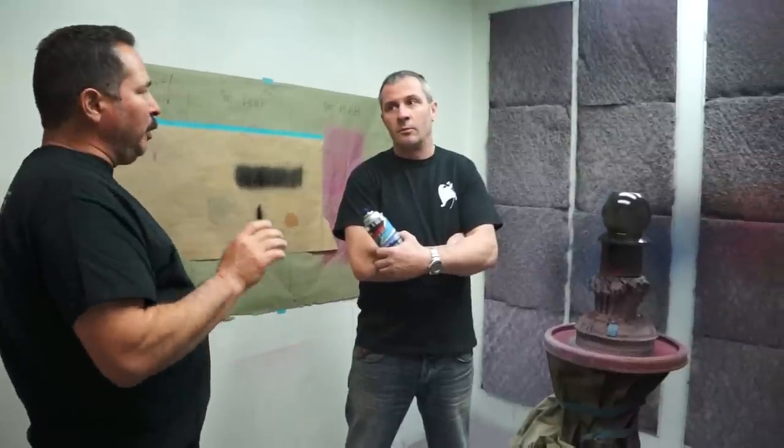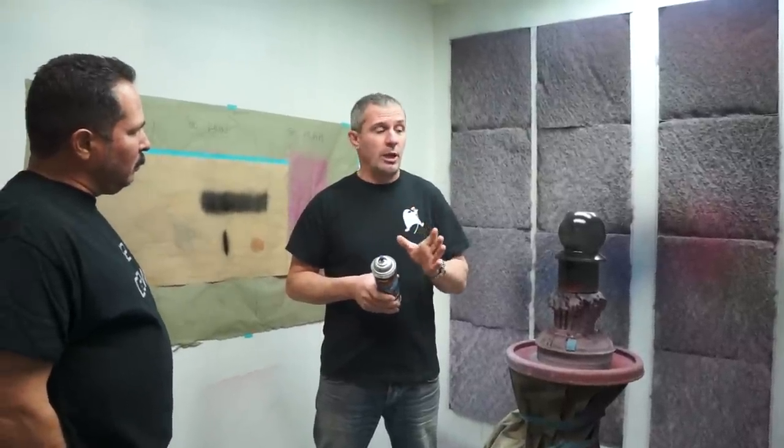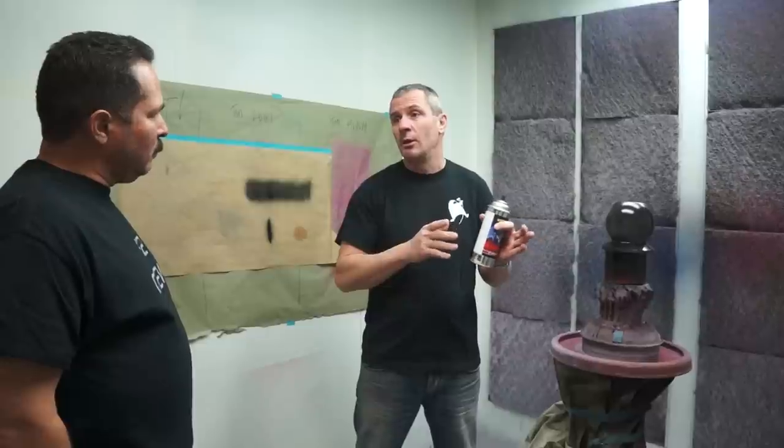Now I'm going to put you on the spot. We talked about reducing in our first video — what happens when people are using the aerosol version? Will they have to warm up the can to room temperature? You always want to spray at at least 50 degrees. Paint starts to become very heavy and unhappy below 50 degrees. Give it a really good shake — it's very important to get the material shaken up. The propellant inside is actually the reducer, so when we fill the cans at the shop we put virtually unreduced paint in so that you get good, heavy, dense coverage. Ideal painting temperature is always 70 to 90 degrees — that's where you want to be. Your part, your room temperature, and your paint all want to be there.